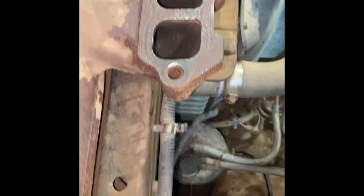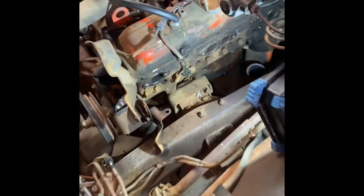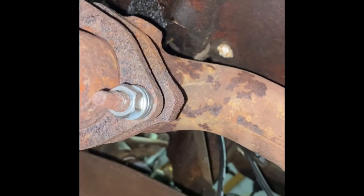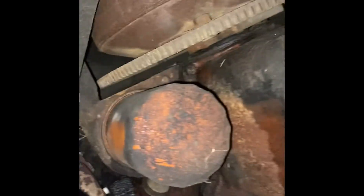Took the wire wheel and cleaned up those surfaces — I think we've got a pretty good contact patch. Going to bolt the manifold on and see what we've got. The manifold is on. I've got to reroute those wires to make them look a little better, but we're just going to test to make sure it's not making noise or has an exhaust leak. The brake hose is now changed, looking all nice and pretty. The lower exhaust manifold is hooked back up — we did have to put some washers under it because the stud is kind of falling apart, but it's good enough for now.